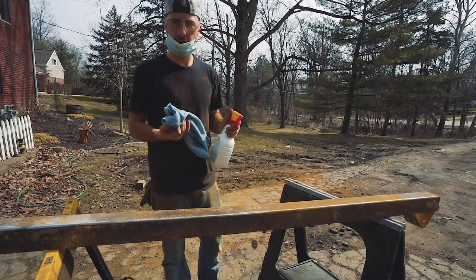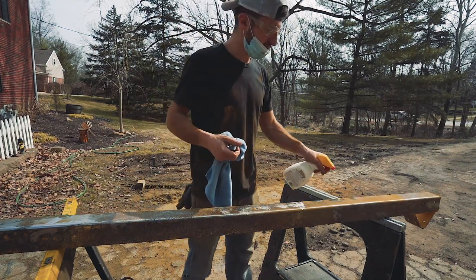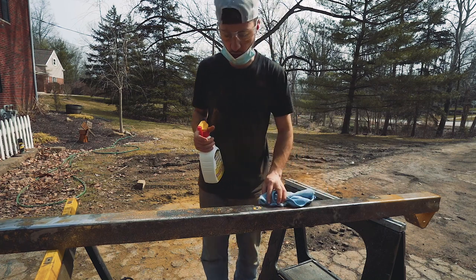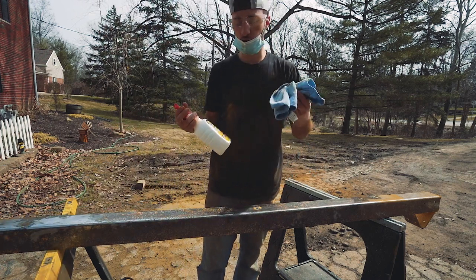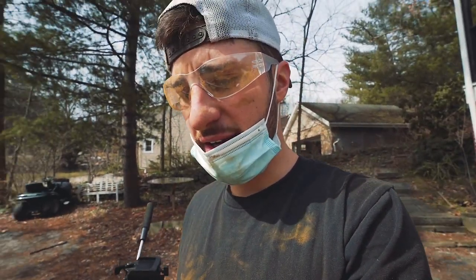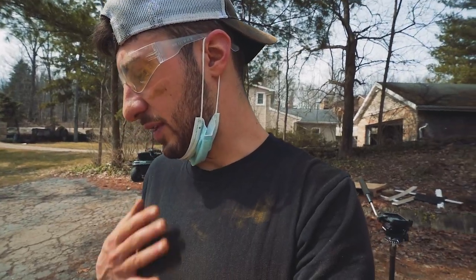For the most part we got this thing pretty well cleaned off. We're going to have to go back and put a degreaser on everything — the only thing I could find nearby was Grease Lightning, which should do fine. The trailer is covered in dust and needs to be wiped down really well. You don't want to use water when doing this because water is just going to make the rust problem worse. I'll use a drill with a wire brush to get the little leftover spots out, and the rest should cover with primer. You can only get it so perfect with something this old.